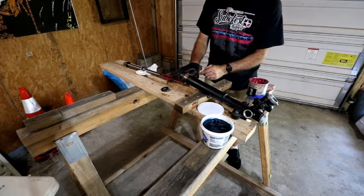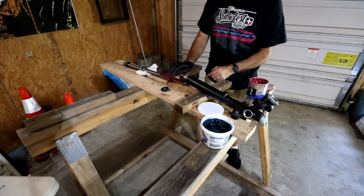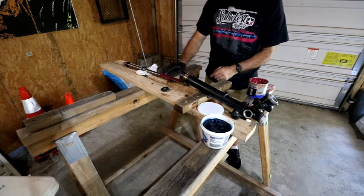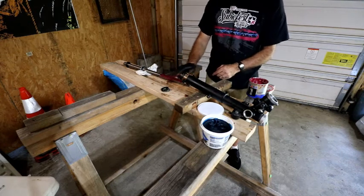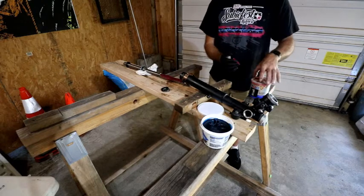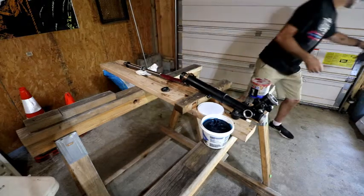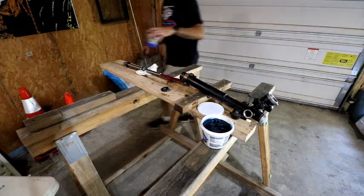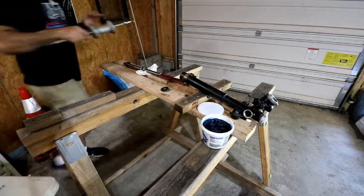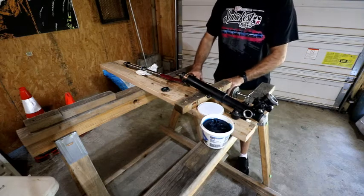Again, this side is a dry side where the gears are at. It does not actually have the hydraulic fluid or automatic transmission fluid, whatever you want to call it, in it. It's just the teeth, or just grease on it. So that ought to do for that. Set this aside for when I do the pinion to slide that back in. And my slide hammer too. I'm going to need that when I'm ready to get this put in.